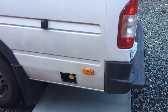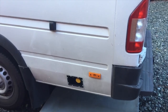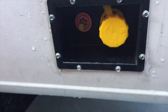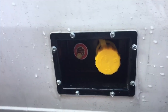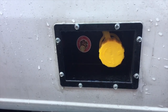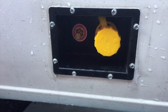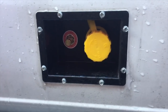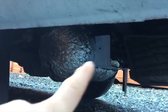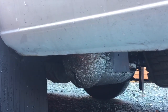We have put in a remote fill kit for the gas tank. At the back of the van I've put in a little hatch — it's just a solid steel port and we have the ability to fire gas in, plus a gas bleed. Just like with a water tank, when you put something into the tank you need the ability to equalize it, which is why there is a bleed. This tank kit connects into our tank, which is this kind of ugly beast wrapped in insulation that sits under the van just behind our rear axle.